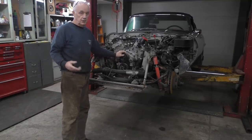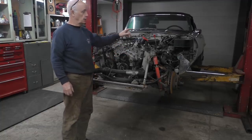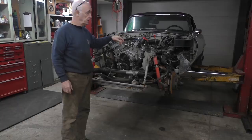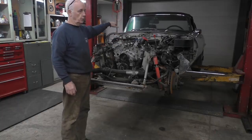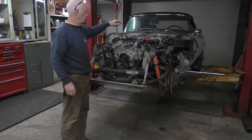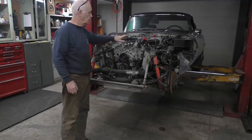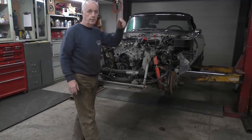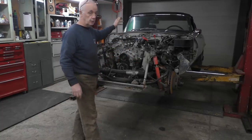As you can see, or as you know, I've got the engine back in. I put the car back on the hoist. The way that I moved it, I jacked up the back of the transmission and put a rope around the transmission and up through the transmission tunnel. Put a piece of wood across the top and held it up there, a tiny knot on my rope, obviously, keeping the back of the transmission out. Got it back on the hoist. Once I lifted it up, I put my transmission mount on. I put my exhaust front pipes on and the rest of the complete exhaust.